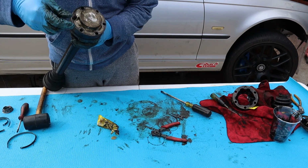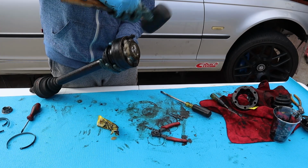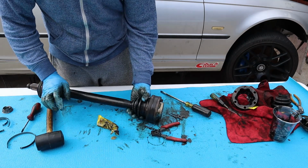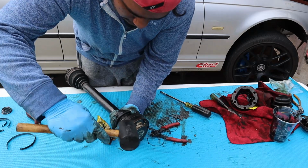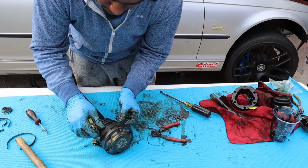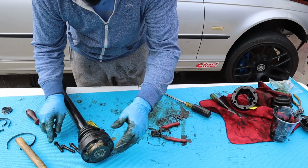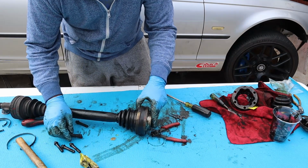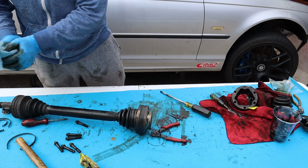And I'm just gonna run through and fill out the bolts which connect the axle to the differential to make sure it's aligned, and now I'm gonna just seal up the cover. So this way I'm not gonna have any issues when I try to put the axle back and the holes aren't lined up. It's gonna be a pain, and you're gonna need room to play around while trying to put the axle in, because I'm basically doing it on jack stands, and I don't want to have any issues while I'm trying to put it back in.